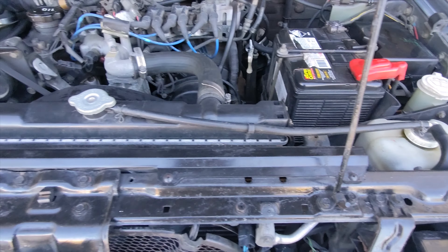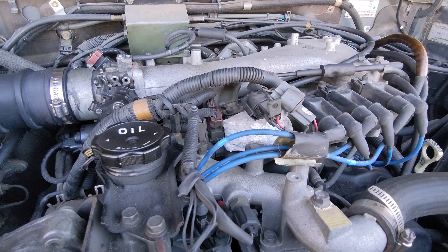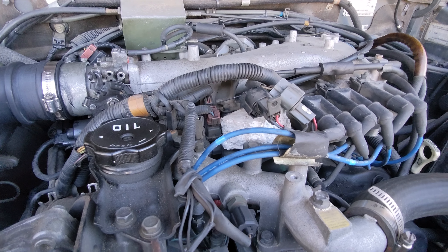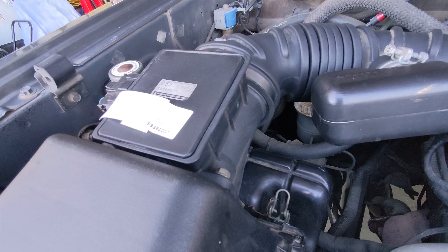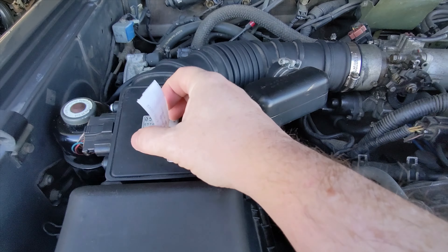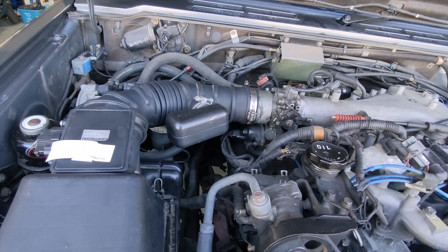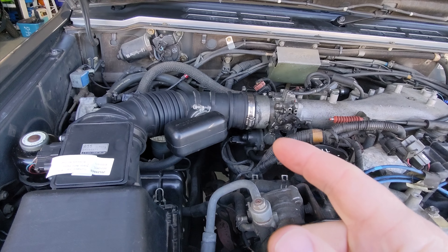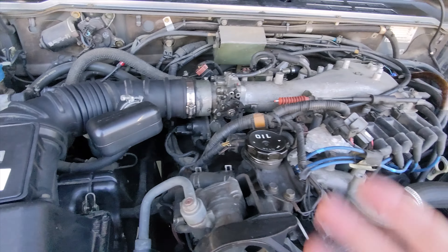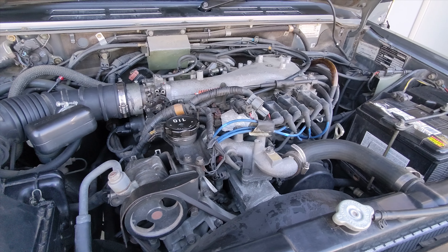What's it got? New radiator — that was leaking. He just spent $900 on a fuel pump and injectors because he never, ever ran it on petrol, so the fuel pump failed and the injectors gummed up. He also spent around $600 on what he thought was a failed MAF diagnosis. The MAF is fine — there's nothing wrong with it. That's what they thought was causing the car to not start on petrol. The gas could be maybe an alpha-N system, which basically means it's just engine speed and throttle position.